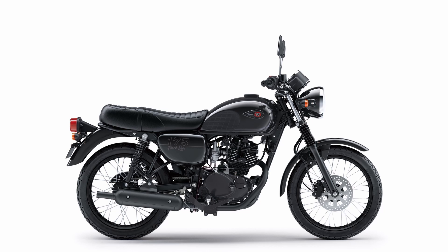Starting with the base bike, we first have to remove several components. We remove the original mirrors, the front turn signals, and the headlight. We also remove the entire rear fender, which also includes the license plate holder, the tail light, and the rear turn signals.